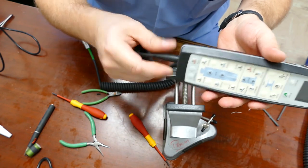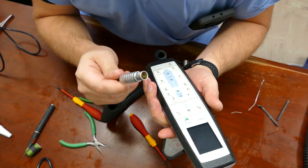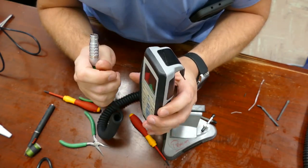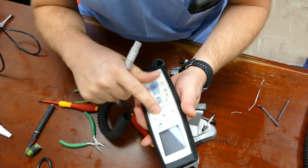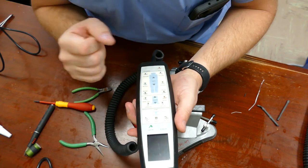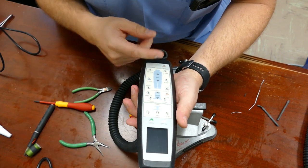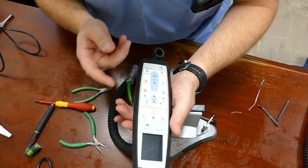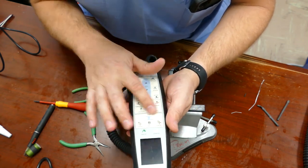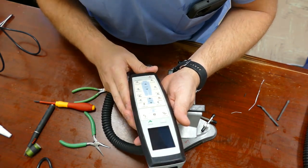I'm going to check the fit and finish, make sure everything looks good, and we are now ready to test it out on a table — the most important step. Always test your hand controls after you fix them. Test every single function. The original symptom was all or nothing — the wire going in is a power wire which powers the display and the computer inside, so when that breaks at the capacitor you lose power and you've got nothing. Thanks for watching guys, hope you like it.